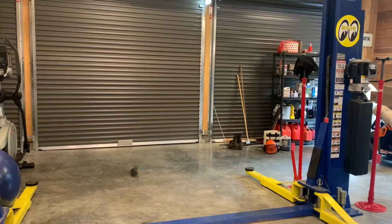Gonna build my dad a new exhaust for over his axle. Not a big long video, but I am gonna try something new with welding the pieces together, like butt lapping, which I saw online. It's like a high heat, low speed technique. It'll take longer, but it should get way better penetration and just be cleaner welds. So we're gonna try it, see if it works.